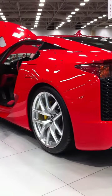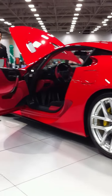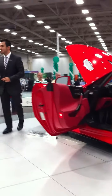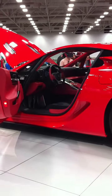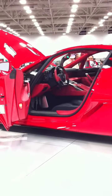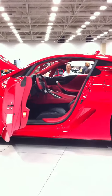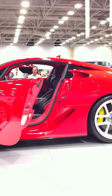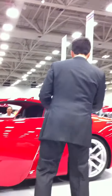And what that does is it brings the LFA to an astonishingly low weight for a vehicle this size. The curb weight for an LFA is only 3,263 pounds. That is it. And there's also carbon fiber in our brakes. Those are composite Brembo carbon fiber and ceramic disc brakes, top of the line. They're 15.4 inches in diameter in the front, 14.2 in the rear, 6-piston, 4-piston, with those calipers right towards the center of gravity for optimum stopping power.